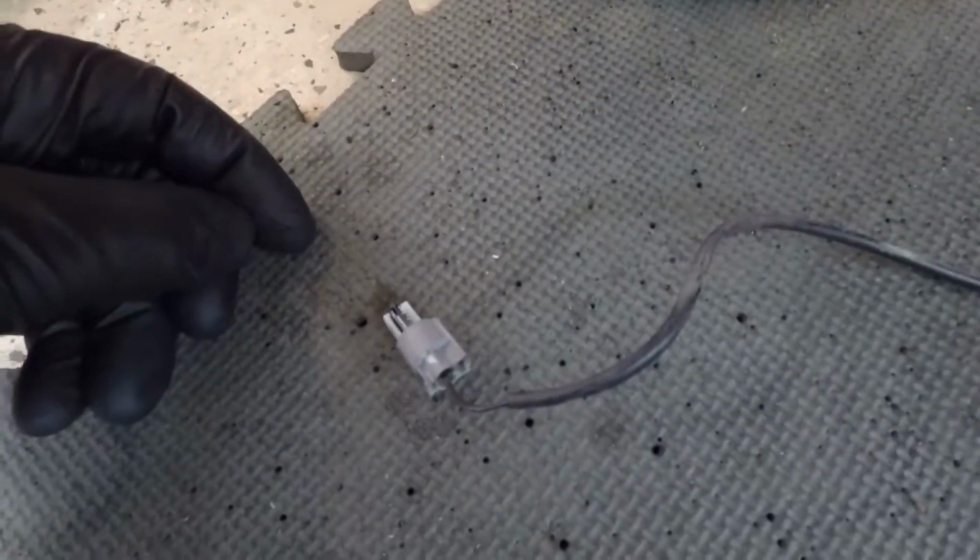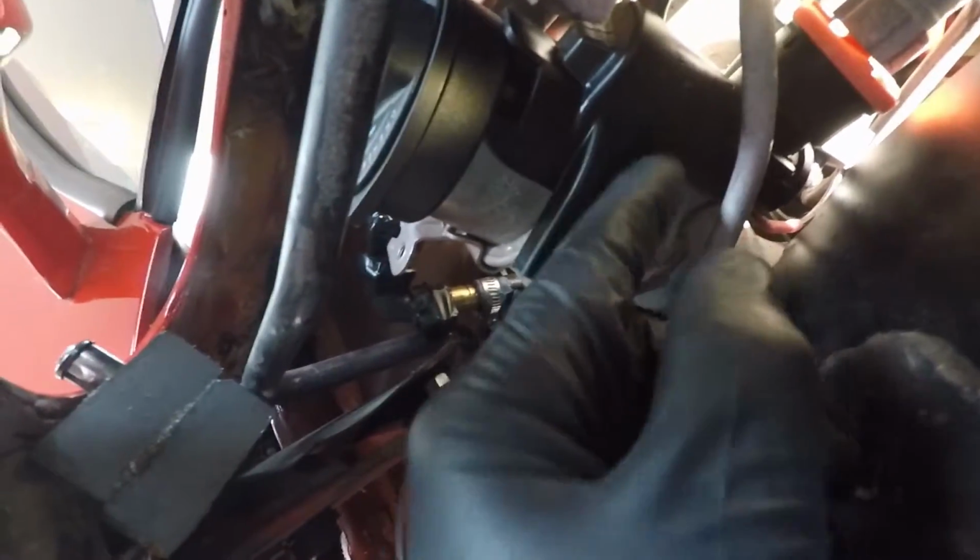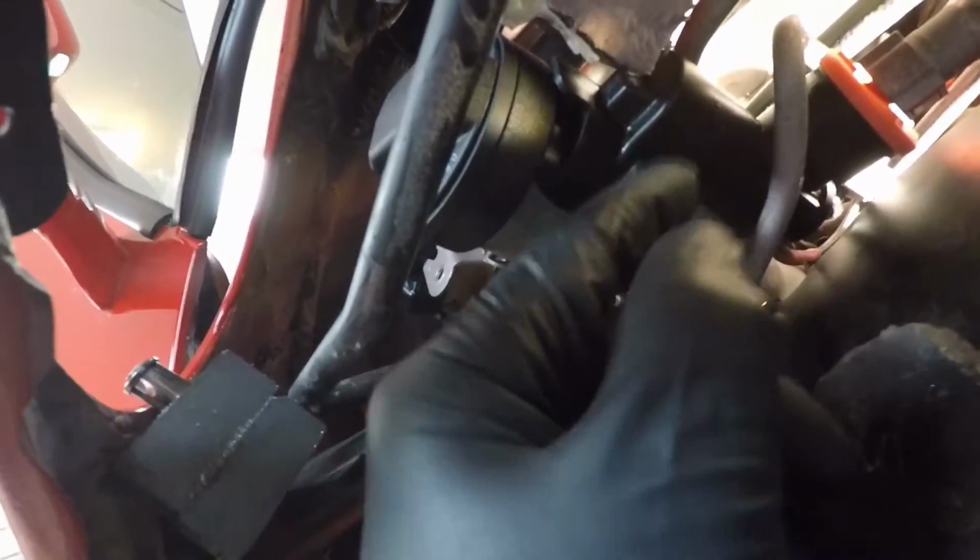This is my first suggested part to replace, and the cheapest. I think it was like $15. So that part gets connected to that connector right there, and it runs down the back side of this device here. It's laying right along this filler neck. It slides up in there and just holds it in place when you push this component back onto that fill tube. And the other thing is, if you don't have yours in a proper position, this thing needs to be oriented, turned, it won't work either when you push in that little latch.